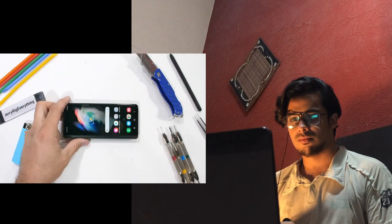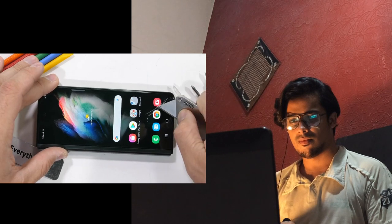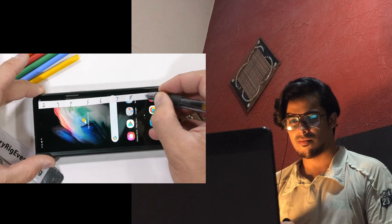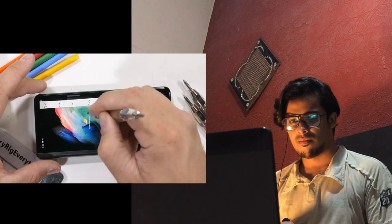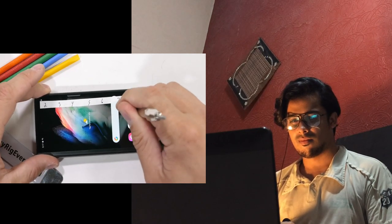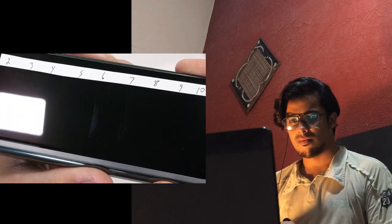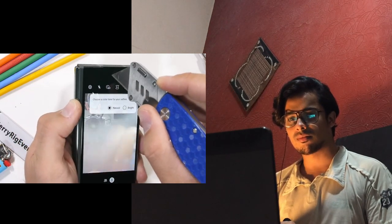Let's start the scratch test. The Fold 3 has two screens. The exterior front-facing screen does come with a removable screen protector. The Mohs scale of hardness helps us differentiate between different materials — like plastic which scratches at a level 2 or 3, glass which scratches at 5 or 6, and sapphire which scratches at a level 8 or 9. Samsung says they're using Gorilla Glass Victus on both the front and back of the Fold 3, and that matches up perfectly with scratches at level 6 with deeper grooves at level 7. The same slab of Victus glass protects the 10 megapixel front-facing camera, as scratch resistant as the rest of the front screen.